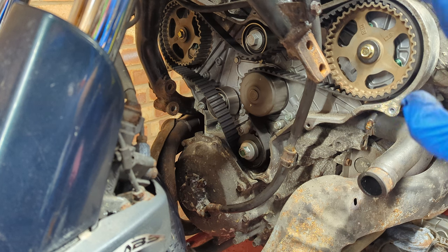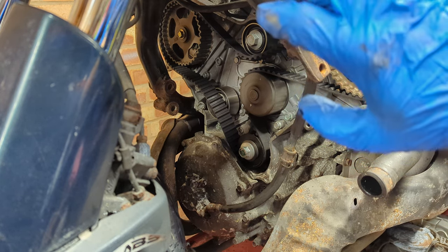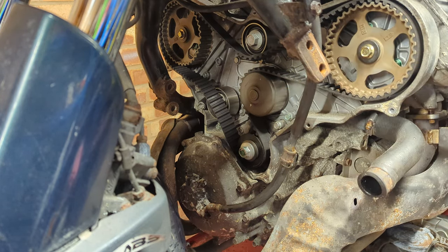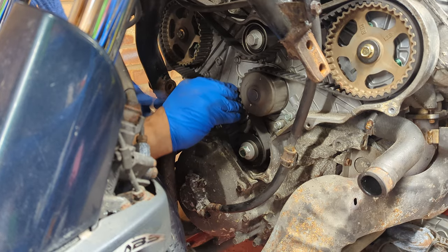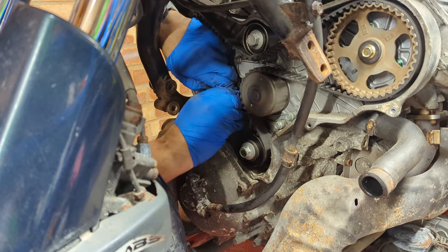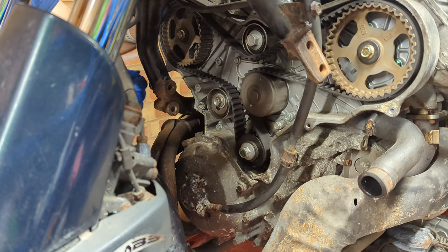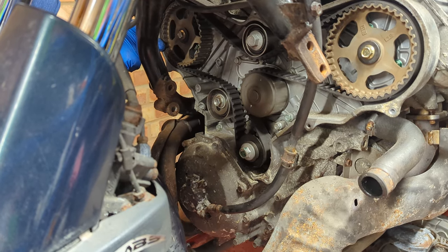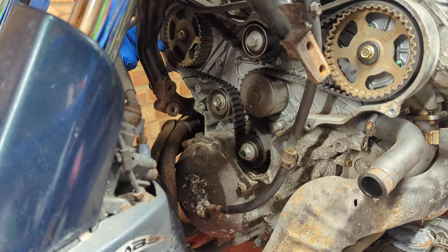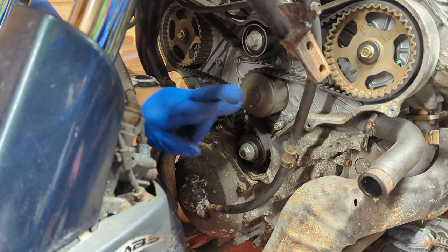You might have to set that back a little bit - put a 12mm on, crank it back, put the belt on. You'll probably see that it will jump forward a little bit as you do it. Just kind of eased forward as I slip the belt onto that tensioner. Make sure everything's back where it's supposed to be and look at the timing mark - now just ever so slightly ahead, and as I rotate this round it's all going to line up, fingers crossed.